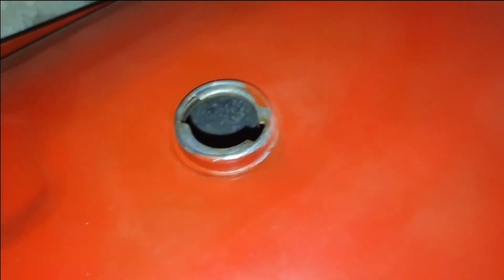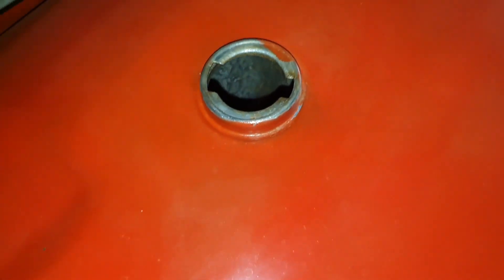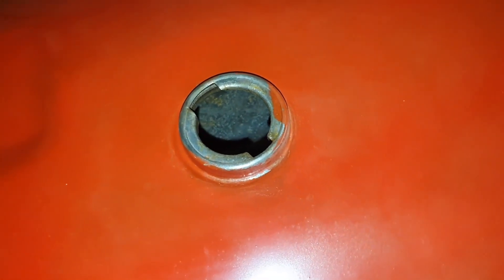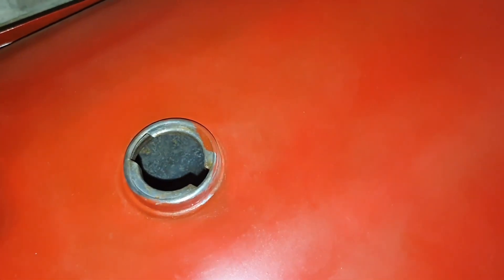The other side I'll just paint black because you won't see it at all — it will face the engine — and I want to save the red for the side wheel arches. That seems to work well. I now have the throttle rod in the electrolysis bath. Thanks for watching. Electrolysis is a cheap way to remove rust — all you need is some water, a battery or good battery charger, washing soda, and some cable leads.